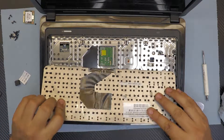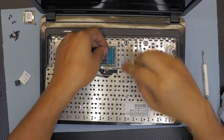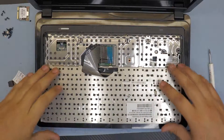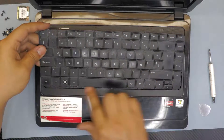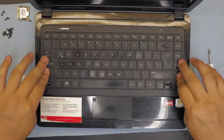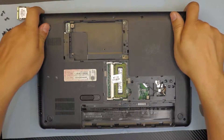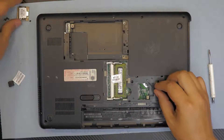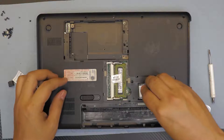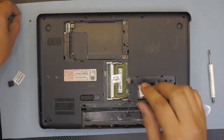Get the keyboard, plug it back in, put it face down, and clean all the dust. Slide it underneath, then close it up. Flip the cable upward, put the bottom end first, slide and push the corners, push the top end — you'll hear click noises, that's good. Close the cover, flip it over. Then grab the Wi-Fi board, plug in the cable first, slide it in at a 45-degree angle, push it down, and put the screw.